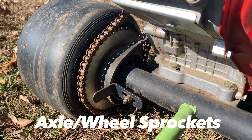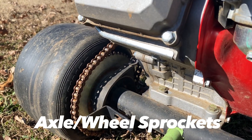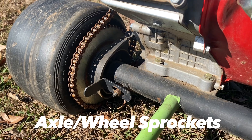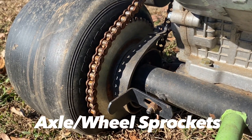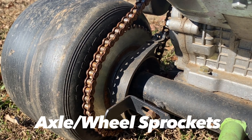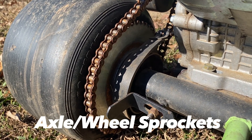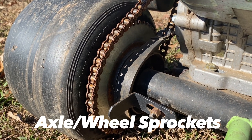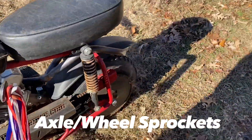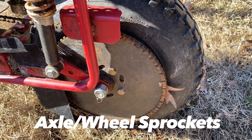In general, as far as drivability, if you're using this for a yard cart or just riding around the yard, people usually like a little more torque because you can go off road, climb hills, and accelerate faster, which is usually more enjoyable. But if you have a mini bike that you're riding on the road and you just need to get up to the speed of traffic, then a smaller rear sprocket might be what you need. It will let you maintain a higher top speed. But if you're starting off from a light, it's going to take you a while to get up to speed. If you're trying to do a wheelie on your mini bike and it's just not getting up, you need a bigger rear sprocket. It'll give it that extra torque and help you get that thing up in the air.